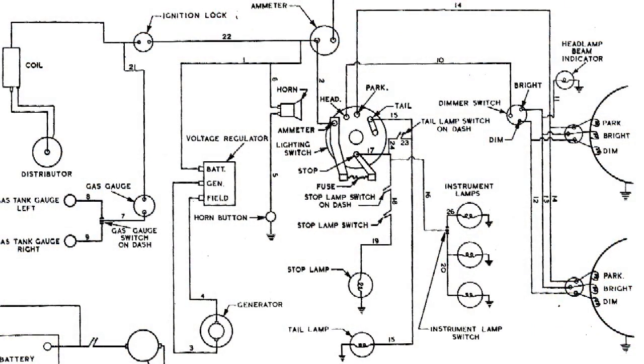To do that, you're going to need to get a wiring diagram and find out which wires signal the gauge from the sending unit in the gas tank. Now be careful with this one. A lot of the late model cars are activated by the BCM, and it's all electronically controlled through onboard computers and data connection lines. So make sure you know what you're working on.